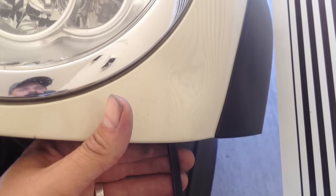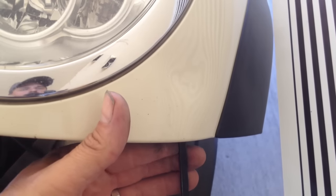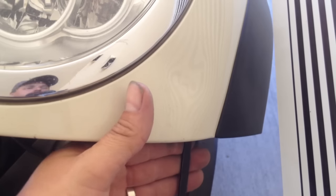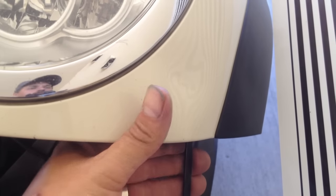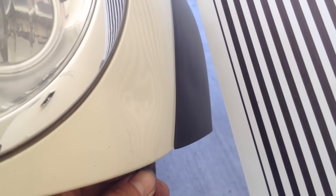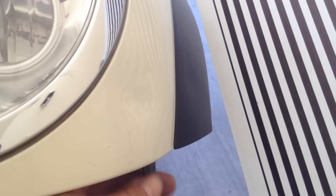The way I lift the dent is by using a series of very precise press and release actions with the tool. With each press and release, I flex the metal outward just beyond level with the rest of the surface. Each flex manipulates the metal, bringing it closer to its original position. I must flex the metal enough to move it slightly without damaging it by creating a peak in the metal.